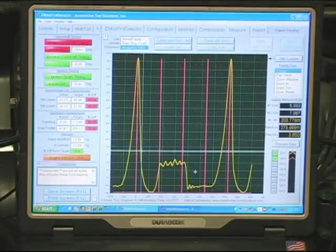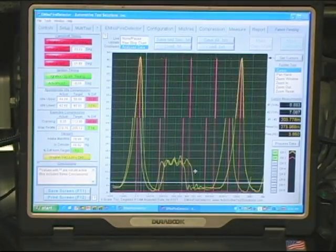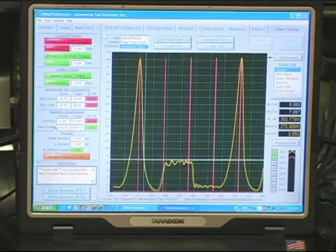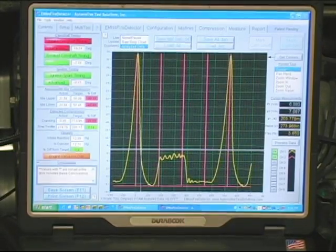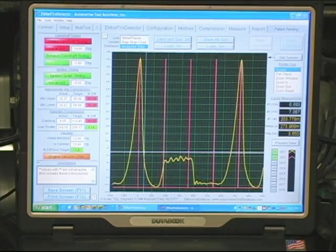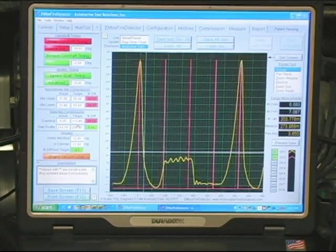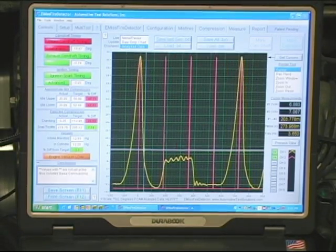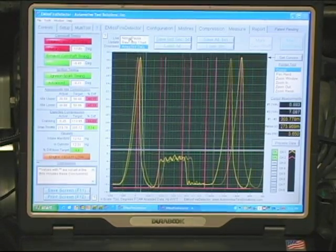Let's do a snap test on the throttle. Now the snap came up very good. The snap actual is 219 and the target was 205. This is because as the speed of the piston is increased, the pressure can't leak out as fast, so I still build pressure. So during a snap test, I only had a 7% differential. The problem with this engine is that the exhaust valve isn't seating.